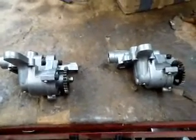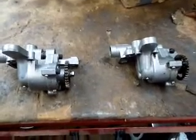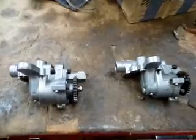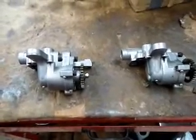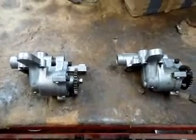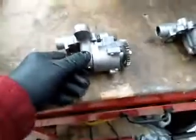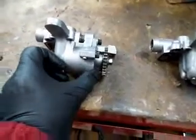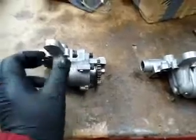other pumps. And when you come down to it, there's actually three pumps, three different sorts, depending on what year you've got. This isn't patently obvious when you try and buy a second one off eBay, but they all have different size rotors. Now this is the one that comes with my bike, which is the correct part, and it's got a 35mm rotor. I've actually finally got a new one and fitted it, so it's all buttoned up, ready to go.